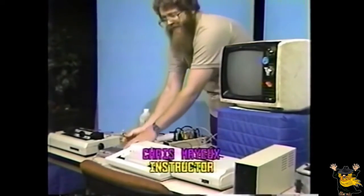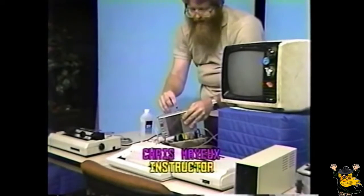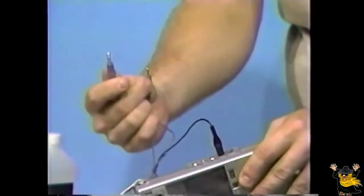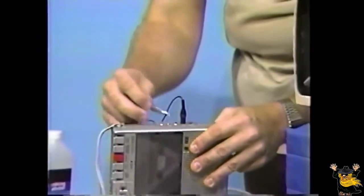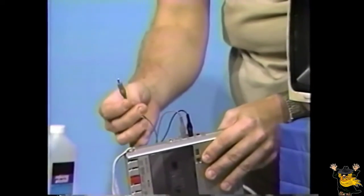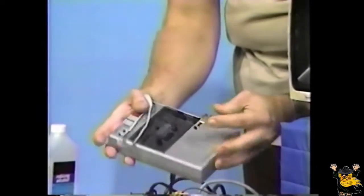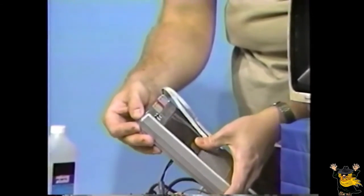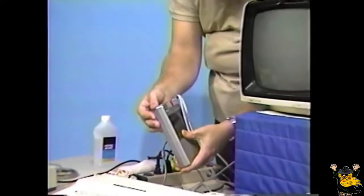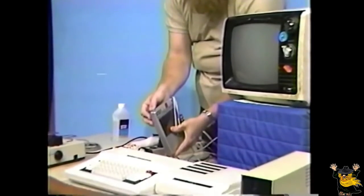On the other end of the cable, take your black connector, plug it into the jack on the recorder marked ear. Take the larger gray plug and connect it to the jack on the recorder marked aux. Take the smaller gray connector, connect it to the jack on the recorder marked rem. At this point, make sure that the volume level on the recorder is approximately 1 unit past the halfway point. Most recorders' volume controls are measured in increments from 1 to 10. This would mean placing it in the 6th position.